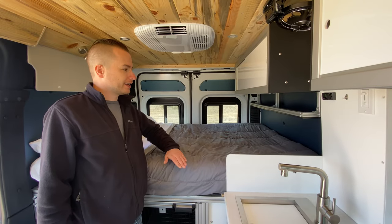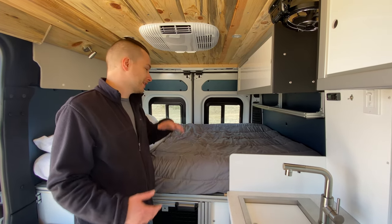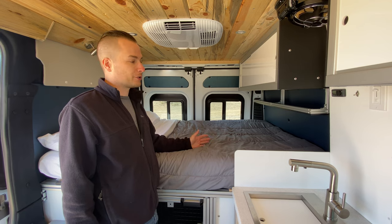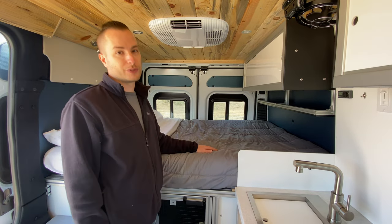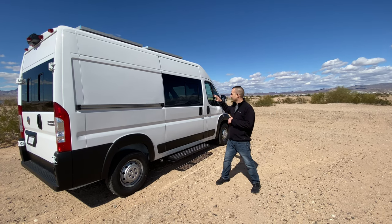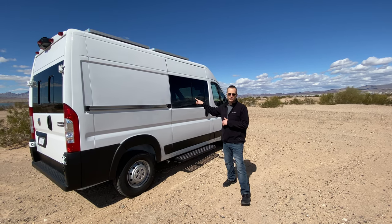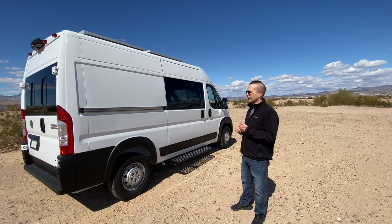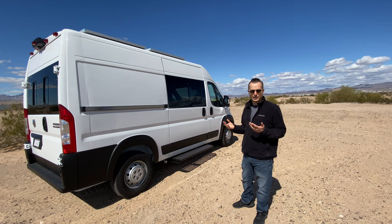We have a normal full-size mattress in these builds on curved wooden slats — a six-inch memory foam mattress on curved wooden slats. Very comfortable, probably more comfortable than you'd think. Those slats do a great job of support and comfort. Our standard windows are in the slider door and on both back doors — all have screens and slider openings, and are tinted. Only automotive glass and only urethane in windows, just like your windshield. No trim-ring windows like you see in a lot of RVs — those don't last very long and we just won't use them.